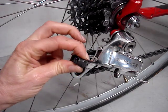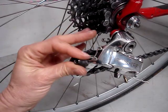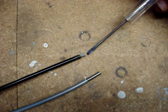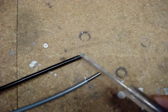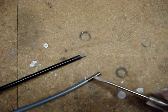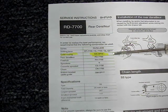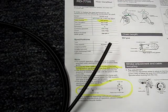It's now turned fully clockwise, and to allow for a little bit of adjustment of the gears later, I'll turn it about a turn and a half counterclockwise. Shifter housing is usually four millimeters in diameter, but there are some exceptions that are five millimeter. It has strands of wire that run parallel with the housing. Brake housing has to withstand more stress, so it's coiled. Shimano recommends their SIS SP40 housing, but I'll be installing another brand of high quality four millimeter shifter housing.